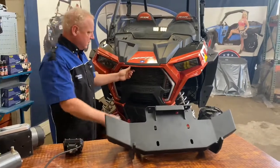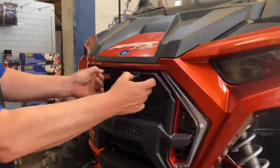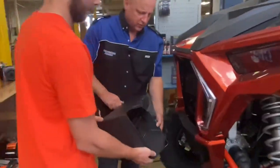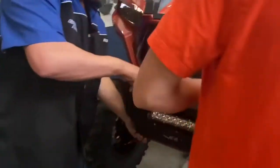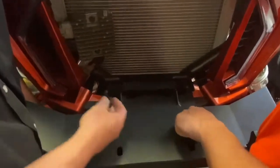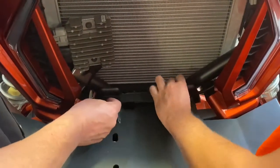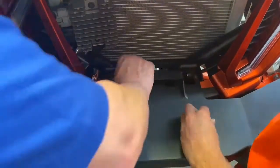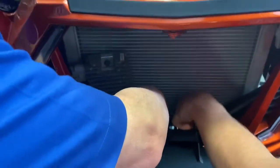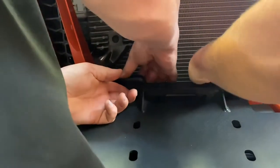The first thing we're going to do is walk over here. There are two little clips here. We're going to unclip this front area and install the bumper. First, we're going to clip it over the top like this and down like this. Then along the top there are four carriage square holes for carriage bolts. We're going to slip that in there, then put the nut on the back with a washer and lock washer, and tighten that down.